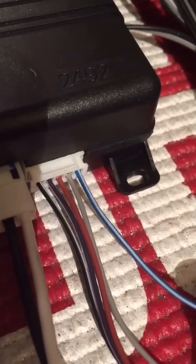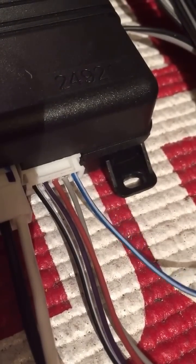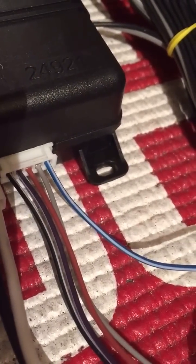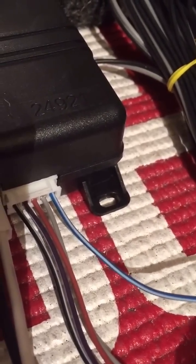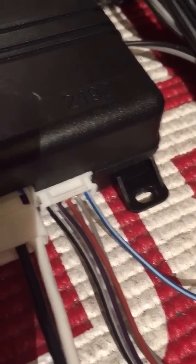There's a small pin harness over here. So this is blue-white — this is going to be your status or defogger output. If you've got to use an immobilizer or ignition bypass, this is going to be the turn-on wire for that immobilizer. Like a lot of newer cars, depending on what brand you get — like an XK06 or some of the older modules like a 555U — once the remote start activates after you've hit the button, this wire gets energized. This is what turns the bypass on right before remote start so your car can think there's a key in the ignition.